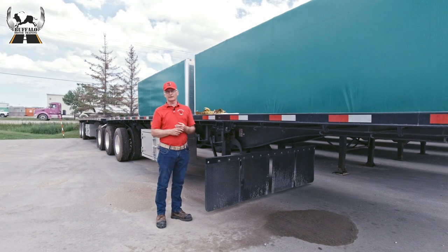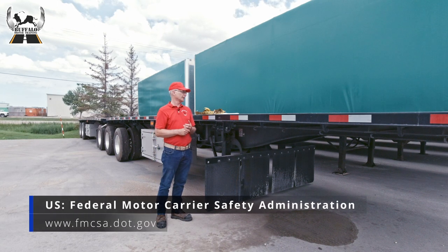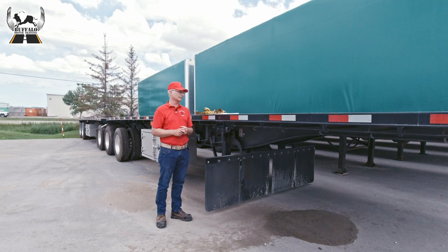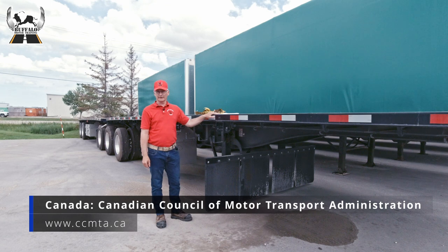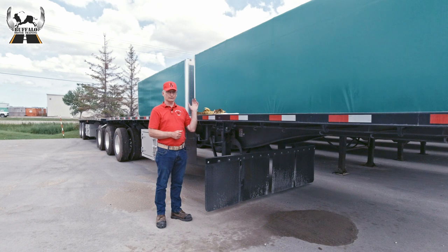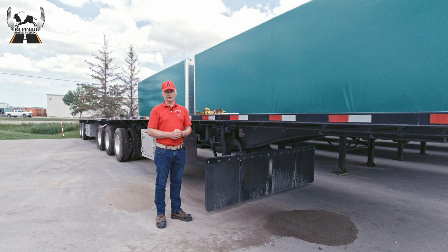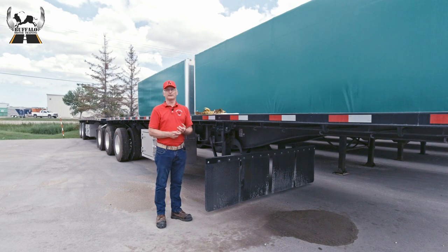For the specific rules and regulations for Canada and the US, those can be found online from the US Federal Motor Carrier Safety Administration for the US rules, and in Canada from the Canadian Council of Motor Transport Administrators. Also, the Commercial Vehicle Safety Alliance, or CVSA, publishes guidelines for enforcement officers to use when they stop trucks on the roadside. Enforcement officers will use those standards to assess whether your load is properly secured. If it's not, your truck could be taken out of service and you could be issued a fine. So it's important at all times to ensure the method you've used to secure the load meets the legal requirements.